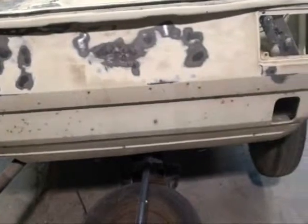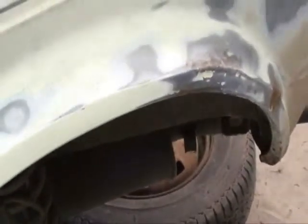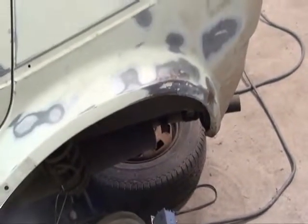I've found no holes yet all the way through, so I've been lucky there. It's a very straight car. As I take these little chips and things off, if I find one that's a bit low, I'll clean that out later by hand and put a little spot of some body putty on there — it's like a little tiny door ding. This rear fender had the worst damage. It has a tiny dent right there, and then a more substantial dent which I've pounded out nearly all the way, and then another little one. This car actually has plastic fender skirts that protect the wheel arch — they go over the top and will completely hide all that damage anyway.